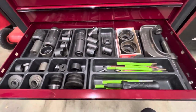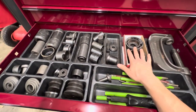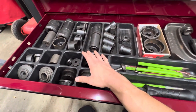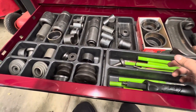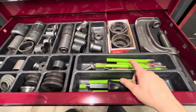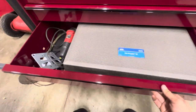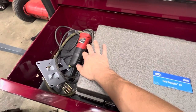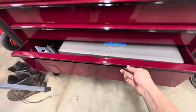And then this is my ball joint drawer basically. I've got my ball joint press obviously, my Honda Acura compliance bushing adapter kit, and then I've got a Honda Acura ball joint adapter kit, plus all of the adapters that come with the BBBPJ1 from Snap-on, as well as the seal kit for that. I've got my chisels and punches from Harbor Freight, which have actually worked really well. And then I've got the OTC hub grappler kit and I have a grinder here as well — just from Harbor Freight, nothing fancy — but I don't use a grinder a ton.